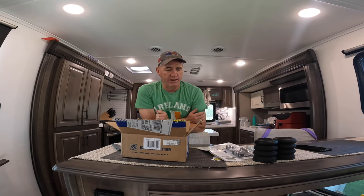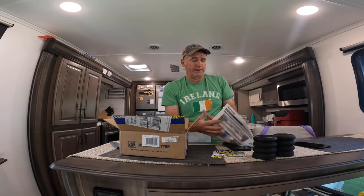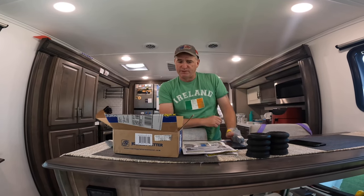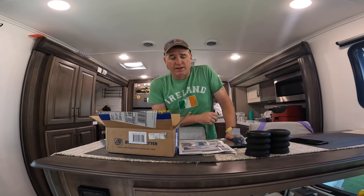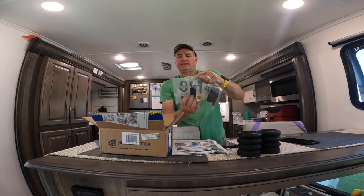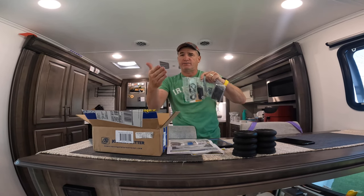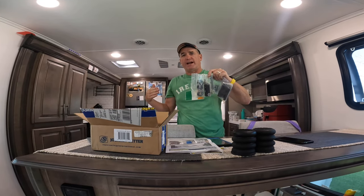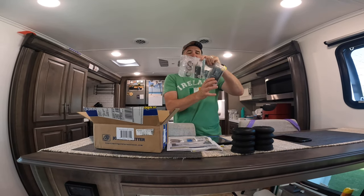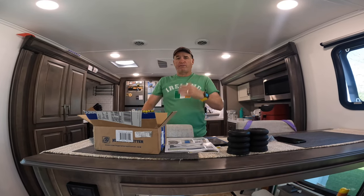The other thing that I really like about these guys is this is set up for camper trailers, okay? This model is. And I believe this one was from 5,000 to 8,000 pounds it will withhold. The nice thing about this is these brackets right here, these are for your gas line. So if you have gas line, which most of them do, coming over the axles by the frame, this allows you to mount this to these guys here and relocate your gas line away from that frame.